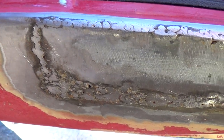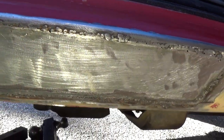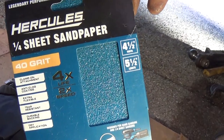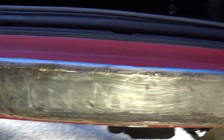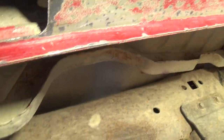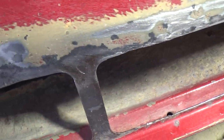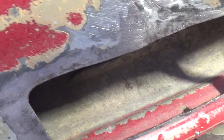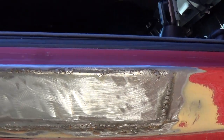I'm using Bondo Glass on this panel. I prepped it using a Hercules 40-grit sandpaper — you can see I scuffed it up a little bit. Underneath is a bit of a train wreck, but I did some straightening of the panel with my hammer dolly set to get some practice with it. Underneath I'm just going to primer and use my E4 Carnal Red paint, and I might throw some Bondo fiberglass underneath there as well.